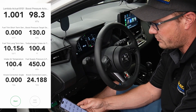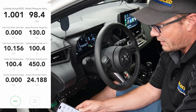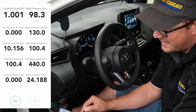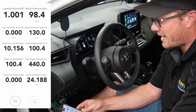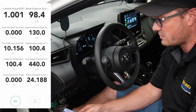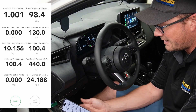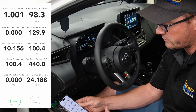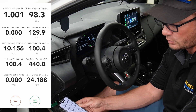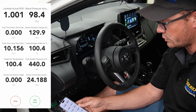That's a good number to keep an eye on. If you're on E40, it's almost always going to be 22 to 24 or hanging out at 24 because you should see very little knock on the E40 mix tune. If you're on 93 it should stay pretty high, at least above 20. If you're on 91 it might move a little lower, but we typically start with less timing on those tunes so it doesn't have to move as much. Also note: from your dashboard you can actually start a log directly — hit the start button and it will start logging everything in the logging profile, not just what's on screen. If you want to catch something, you can do it from here, then hit stop and it's done.